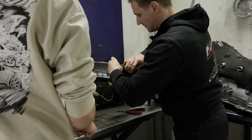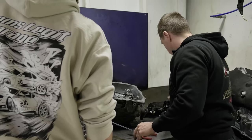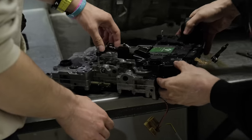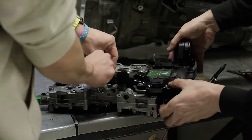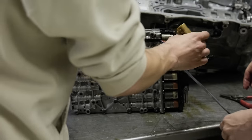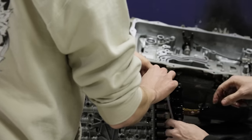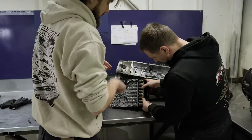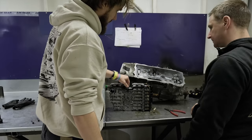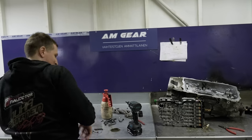So you just pull it — yeah, it goes. Exactly. And we just put the new TCM on it. First we put it in here — yep, it goes there. It's nice and even. Now this goes through this hole, underneath this plastic cover, plugs right there. This goes to HIS, like this. And then just bolt on — reinstall the bolts and that's it. Some torque, a little torque.